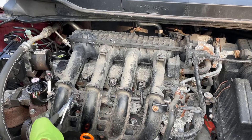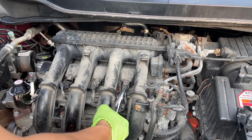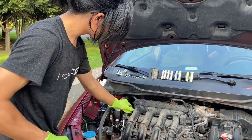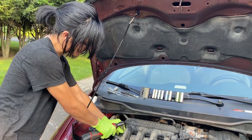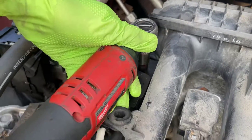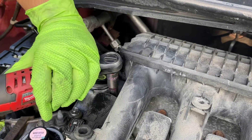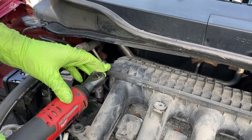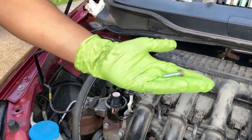Let's pull these out. Let me just double check — it's 10 millimeter. You might need to use an extension; in our case it looks like we won't have to. We're going to loosen it. These shouldn't be too hard to loosen because they're only about eight foot-pounds of torque, but these could be rusty, so that might be why it's a bit hard initially. This is what one of the bolts looks like, and you want to store that somewhere safe.